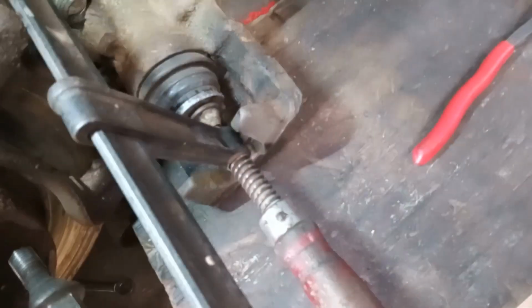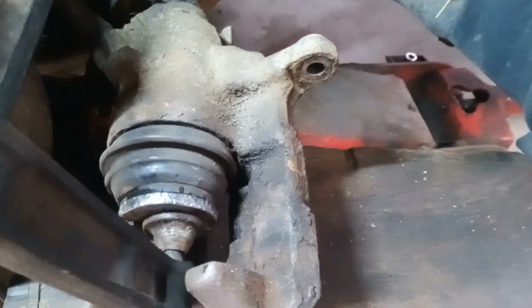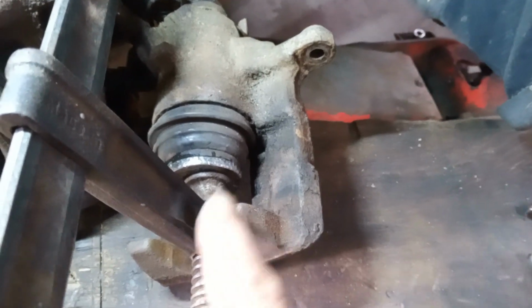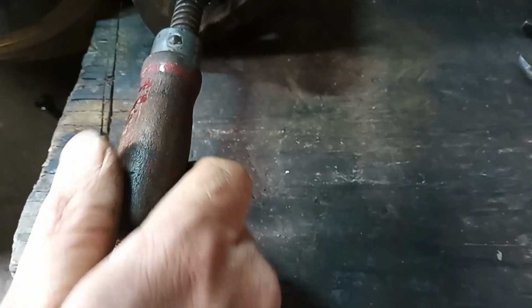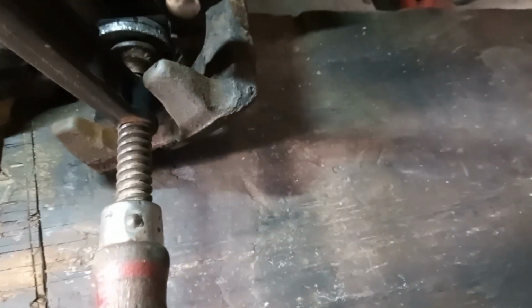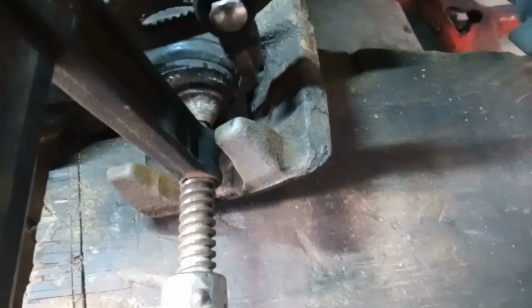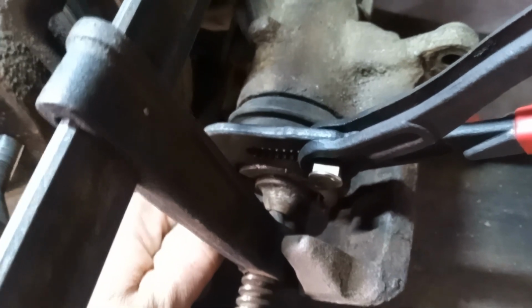Let me get you set up here, right? So I've put a little bit of WD-40 under here to get it moving nicely. I think someone else has had a go at this already. I've got my clamp set up, just nicely on there. It's not that tight, right? Just gentle pressure. And I've got trusty grips. And again here, do not snag the dust boot with your grips, right? Be very careful like that. And if I can do this and hold it at the same time, which is proving difficult, I'm trying to set you guys up somewhere so you can see.